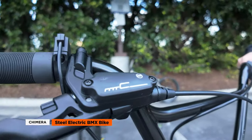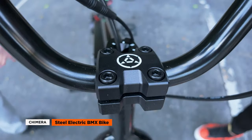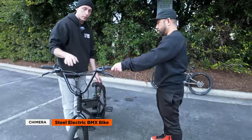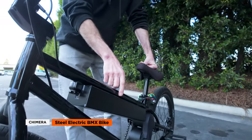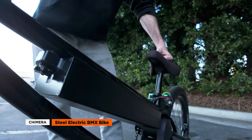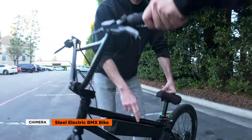These brakes can be upgraded to the MT. We make our own stems, stem fork bolt, frame fork, handlebar, and hubs — those are all our design. The bike weighs 45 pounds but runs at 3,800 watts, so a very impressive power-to-weight ratio. We thermally encase Samsung 50S cells inside an aluminum case. This is a battery that is much more shock absorbent, water resistant, and most importantly fire resistant and puncture resistant than other batteries on the market.